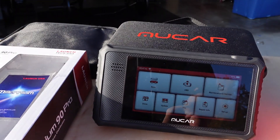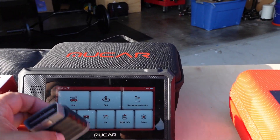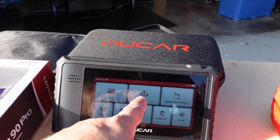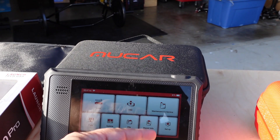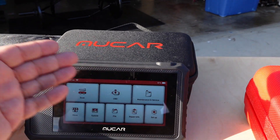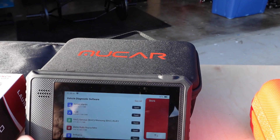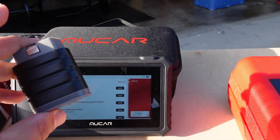A lot of times these scan tools are going to be Bluetooth, so you can work outside of the vehicle and basically be in your shop troubleshooting what's happening. You can scan the OEM side — the manufacturer side — and the OBD2 side. You can also do certain resets. For example, you can service the rear electronic parking brakes, which you can't do on a newer vehicle without one of these scan tools. Some of these scan tools have a built-in store, so if you want to unlock some of the bidirectional functions, you can do it on some models.